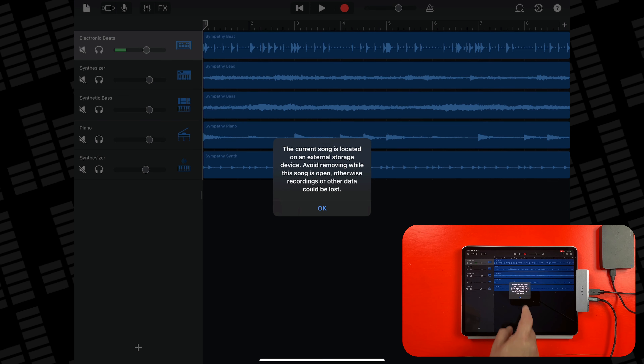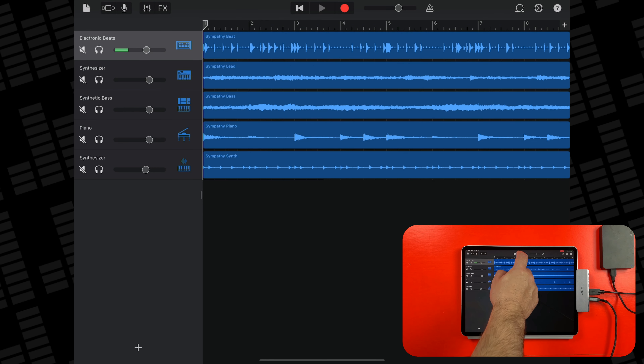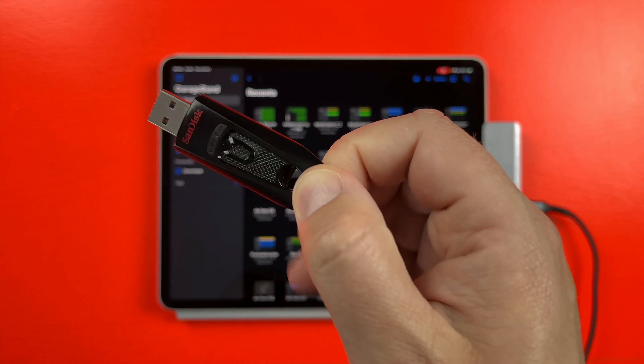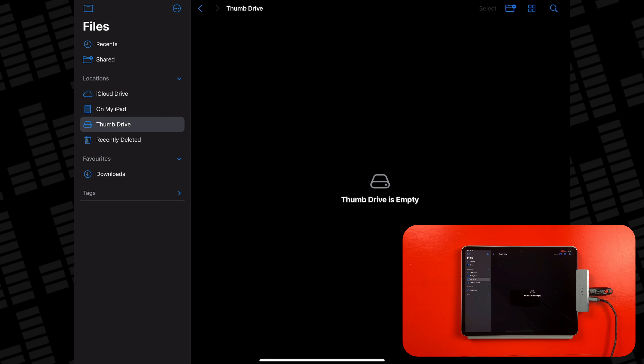This Anker adapter has an HDMI port, a USB-C port that allows for pass-through charging, a USB-A port, two SD card slots, and a headphone jack. To use this hard drive, I just need to attach the adapter to my iPad, attach the iPad's power cable to the USB-C port on the adapter, and then attach the hard drive. If you have a Magic Keyboard, you can actually use the USB-C power input on that to provide power to your iPad and your connected drive without having to worry about an adapter.